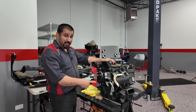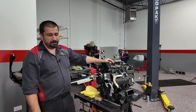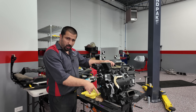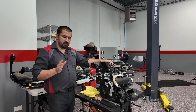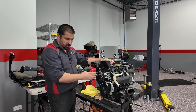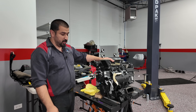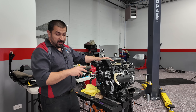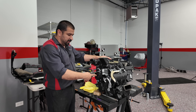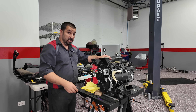What happens with these servos is the motor gets weak and starts overheating, and that overheating wipes out the position sensor. Now it doesn't know where this servo is. If you put it to full cold, it'll stop clicking because it established the position, but when you put it to full hot it goes and goes, reaches the end of travel, and starts clicking and hunting back and forth. We've actually had a case where the HVAC controls would lock out completely because the servo check was incomplete.